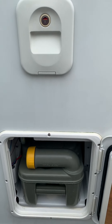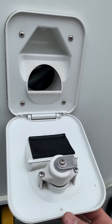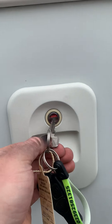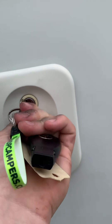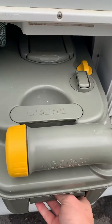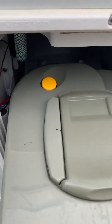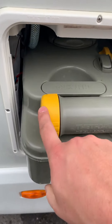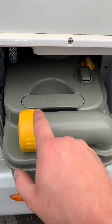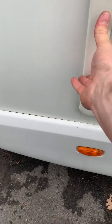Toilet cassette locker — you've got your flush fluid up at the top. You need to pre-mix your pink fluid and pop that in there, and that's how your flush gets pumped through. When you go to close that up, you can also lock it by putting the key in, turning it whichever way it'll go, and taking the key out — so now you can't take that out at all. The actual cassette itself comes out just by lifting up on this little yellow lever at the bottom, then pull it all the way out. When you empty it, hold this little yellow button down at the back and empty it through here. Once you've done that, put your blue fluid — about a cap's worth — in there, swish it around a bit, and just push it all the way back until you hear that click.